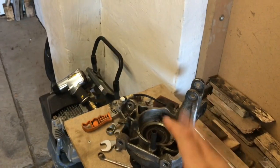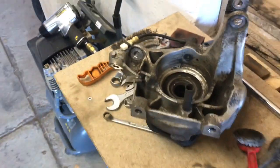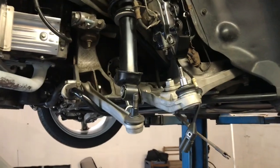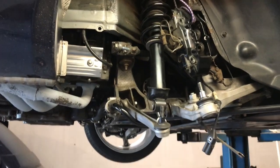The specialist said the hub has been damaged and needs to be replaced. The new one is over 500 euros, so with the costs of the Land Rover I've been holding back. Now I've got a bit of time and I want to get this back on the road. The first step is to get a new wheel hub, complete with bearing, ABS sensor and everything, and I've got one lined up ready to go. In the meantime I'll also replace suspension parts on both sides — four parts, two each side — the only ones I didn't replace when I originally did the suspension.